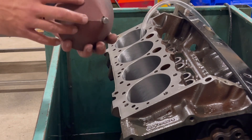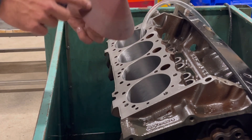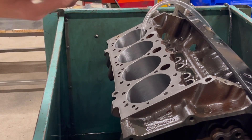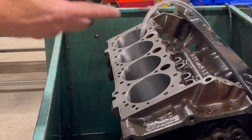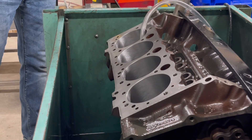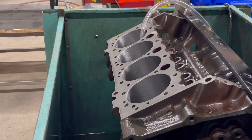This is a really good tool — a DIY type thing. The nice part about it is it's affordable. The mandrel is very heavy duty, it's going to last a long time, and you can get these cones pretty cheap. This is the 45 degree set — I think you can get the cones for maybe around 20 to 25 bucks a set. I'm going to put a link in the description to Goodson so you can go there and order your own. When you can do things on your own, you don't have to have fancy tools — that's a huge plus and a huge win for all of us.